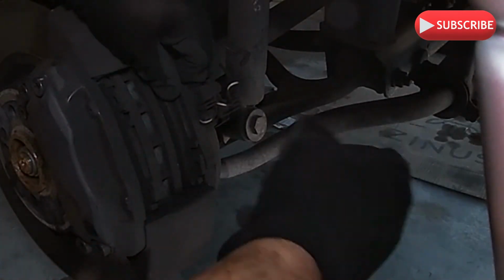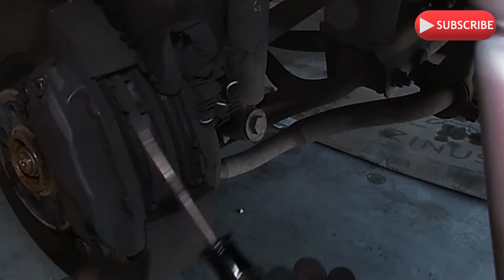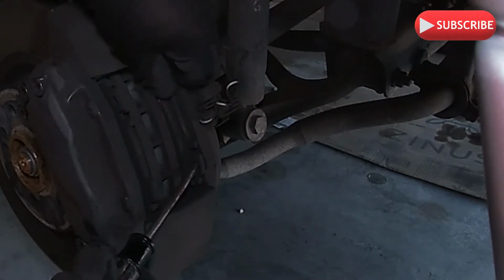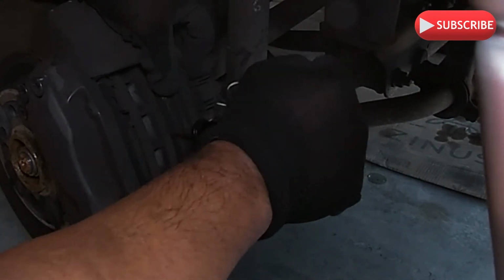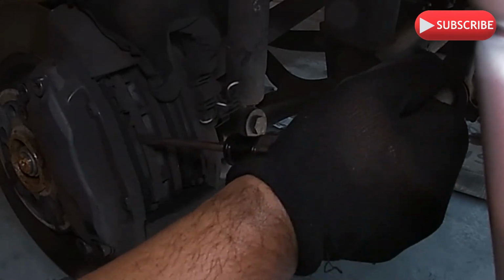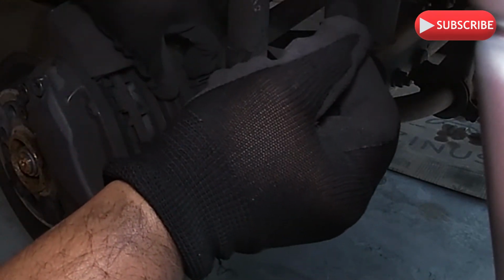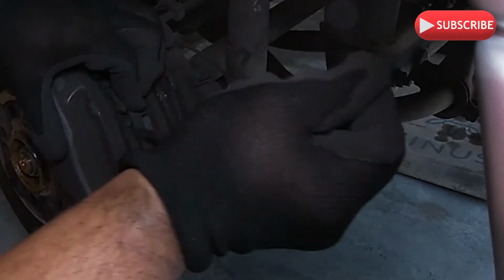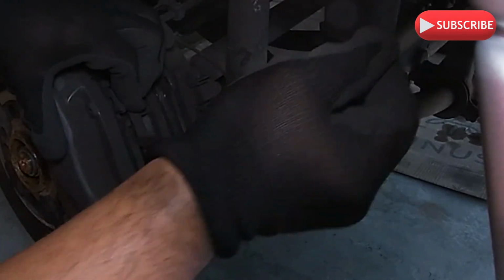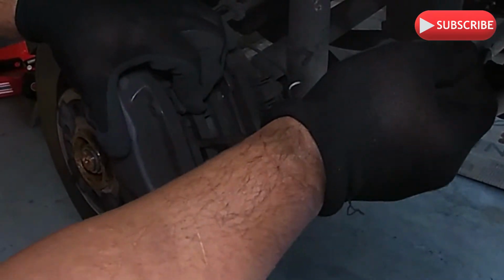And then same thing for the other side, but don't take this out yet. Because if you push this side, that's gonna push back out. You got it. So I'm gonna push this all the way in. Okay, now I got room for this one. See? So keep that in there. Because you wanna get all those pistons reset at zero.